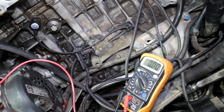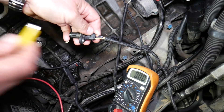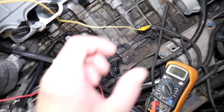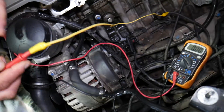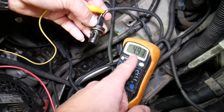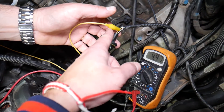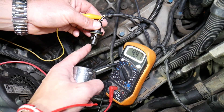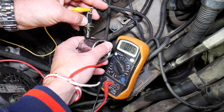We're going to plug the sensor back into the connector. Now we're going to use an alligator clip to attach to the wire that we peeled loose — if you don't want to peel it, there's a special clamp device you can use. Connect the red lead to the yellow signal wire and the black lead to ground anywhere on the engine. You should get a reading of about 5 volts on the voltmeter. Now if I approach the sensor with a big piece of metal, it should read zero; once I remove it, it should go back to five. Watch: zero, five, zero, five, zero, five.